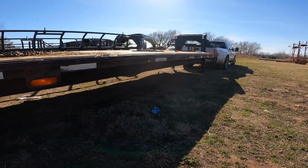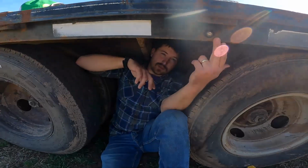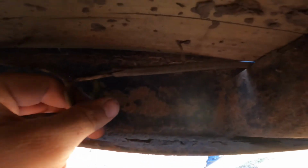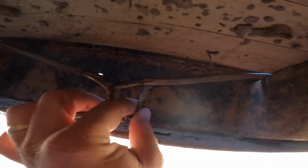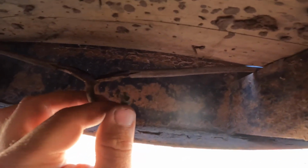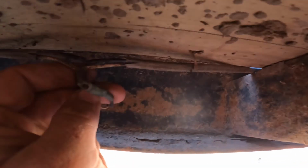All right. As you can see, the lights are working all the way up until this point. And so we stop here and check to see whether we have some broken wires. Usually that's pretty typical, and that's why they're not working. LEDs really don't go out very often. However, that one did, evidently. I even checked to see if it was a bad ground, and it was definitely a good ground. So just a bad LED. It does happen, I guess.